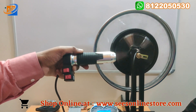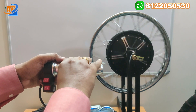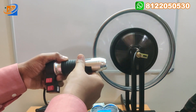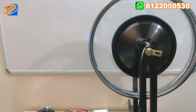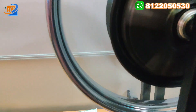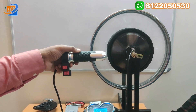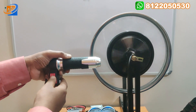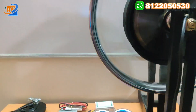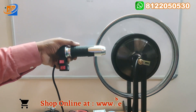Now I am in the second speed — accelerating step by step you can see the difference. The total speed in second speed is 58 kilometers. That is the high speed this 18-inch 1000W hub motor at 60V achieves. This is the maximum speed of this hub motor. Second and third speed will be constant — I am changing to third speed and you can see there is no difference. In the speedometer, third speed also shows the same kilometer as second speed.